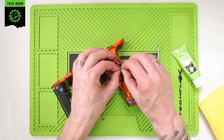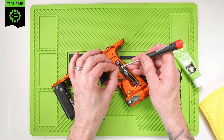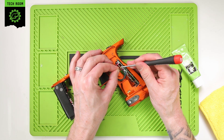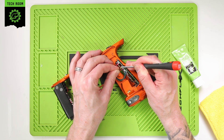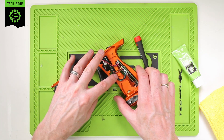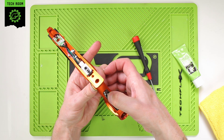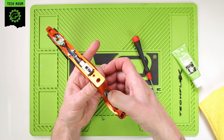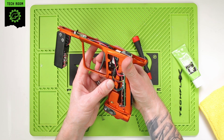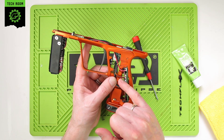Now plug that back into the MME board. Don't push on top of the wires — don't stick your finger on top and push down, because that will compress the wires and potentially snap them. Instead, apply pressure just to the top of the plug itself and push that back into place. It may be worth at this point checking that the solenoid is all connected properly by powering it up and pulling the trigger. You should be able to hear the solenoid or pilot valve clicking, which means you've reassembled everything correctly.